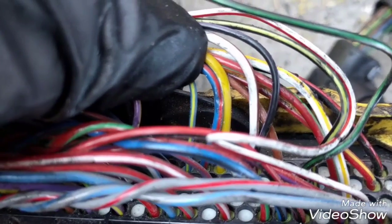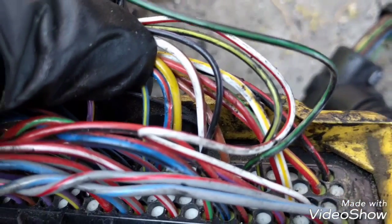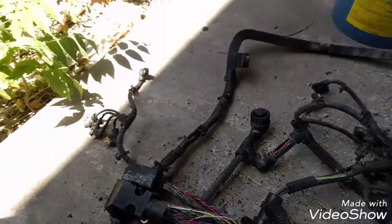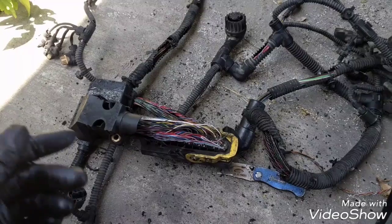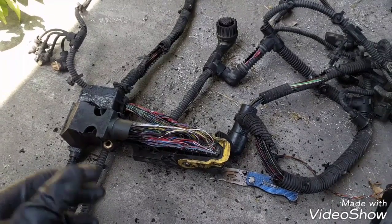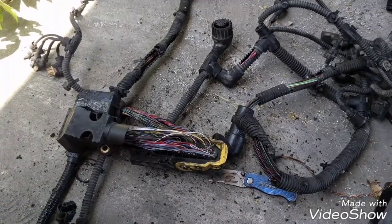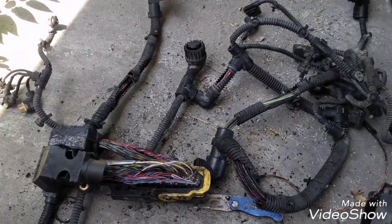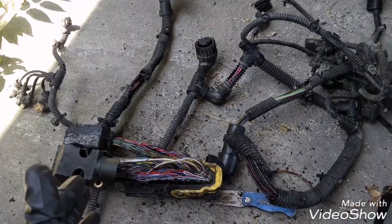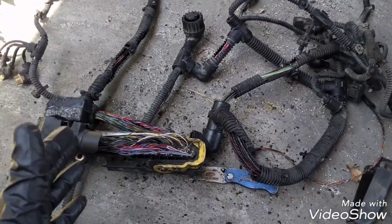You can see here, you can see there, that one is about to get peeled. So that causes so many problems like check engine light, engine shutting down, EGR valve not responding, coolant low, water in fuel — so many problems that the harness can cause because it controls almost anything around the engine.